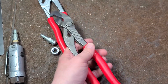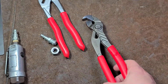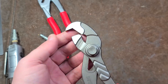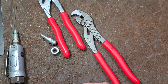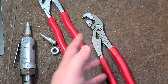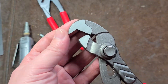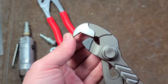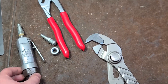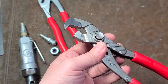So that's my opinion about these — too long a video. I was hoping these would grip a whole lot tighter than they actually do. It's just something to be aware of: when I use these I'm going to have to make sure to actually grip them pretty tight, otherwise they're just going to end up rounding out my fasteners. So I think they'll be better for doing things like working with air fittings. I should even put a caveat to that because usually you want to use flare nut wrenches on any kind of really jammed flare nuts or any kind of nut that is hollow — you want to use a flare nut wrench because when you're putting a lot of force on just two sides, it's easy to squash them, particularly like airlines, oil lines, that type of stuff.